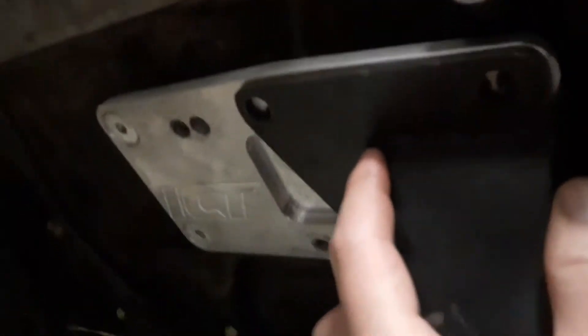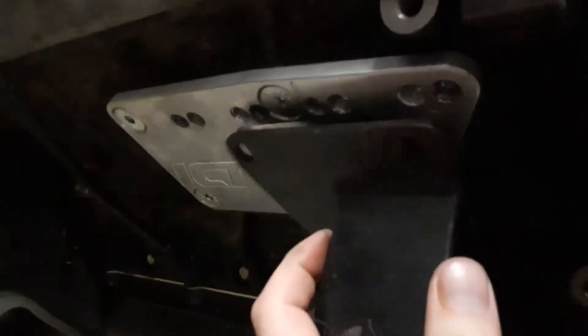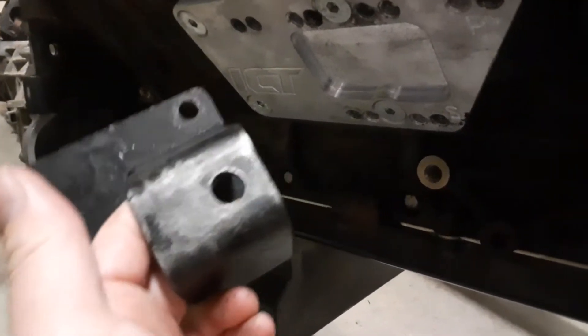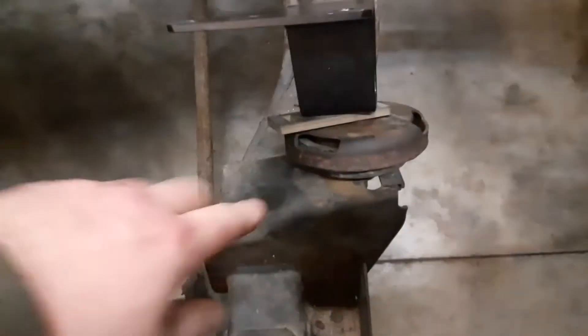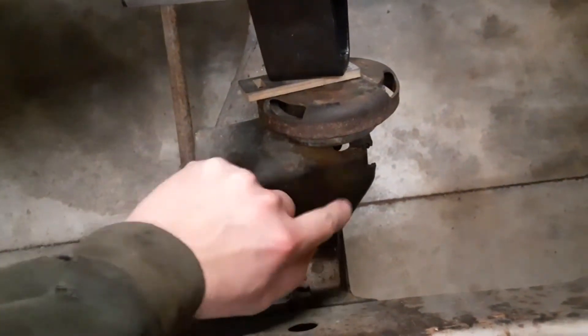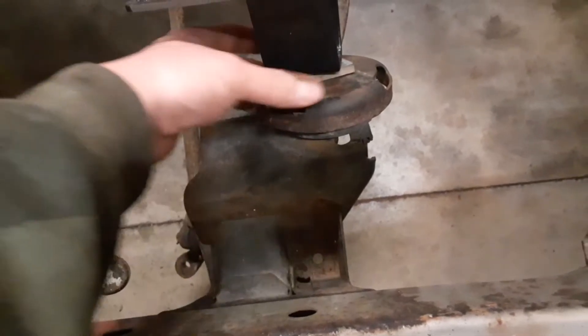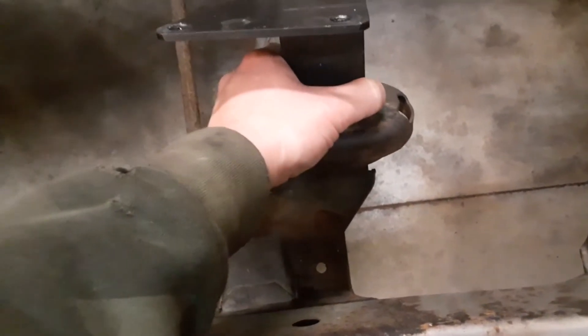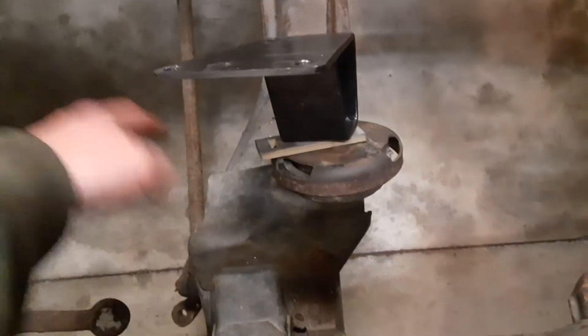The passenger side is a whole different situation. Because of the way things end up, you put the passenger triangle pointed backwards again and then go to the first bolt hole here — that's because of the offset of these mounts and also the offset in the subframe itself. One last thing: this side of the engine mount pad for the subframe has a J-shape. You're going to have to loosen the bottom nut — 17mm wrenches or sockets — then slide it up, out, or forwards, and then up. Because we're adding height with this pad, this helps compensate for it, and then your engine will fit. If you don't do that, the engine will not fit.